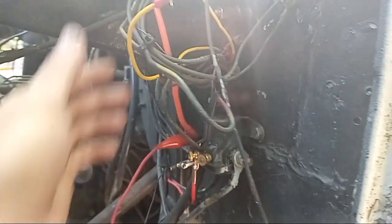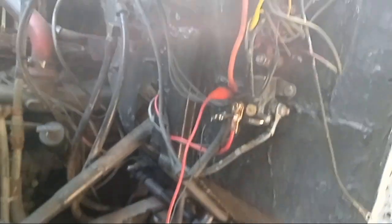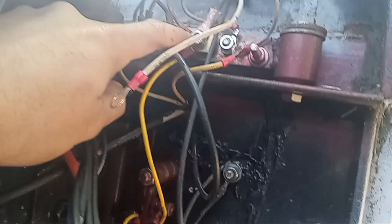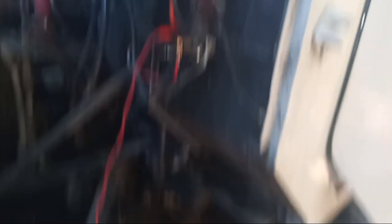I don't like connecting wires to other wires — you need a common spot like I have here at the terminal bar. I know it looks a bit messy, but it's organized. I know what each wire does. You have left on the left side for the turn signal flash, right on the right side, and there's a reverse — nice and organized.